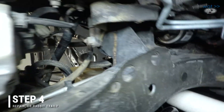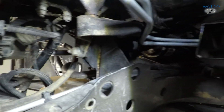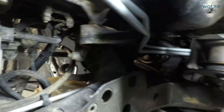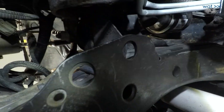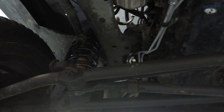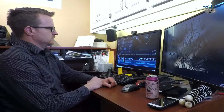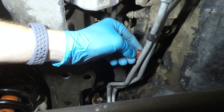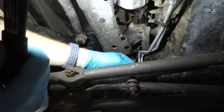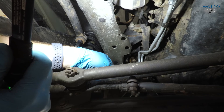It's now happened a second time and I'm done with that. It was on a four-wheel drive trail, nothing unusual with the sway bar attached, so it's not like it was over-flexing. Thankfully it had already crimped the lines so much that it wasn't leaking very fast. So it's time to reroute those lines. This is a piece of three-eighths copper line — same diameter as the existing line as far as I could tell with my calipers. I'm going to cut this off, apply some compression fittings in line, and reroute a longer section of tube around the trouble area to hopefully finally deal with it.